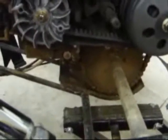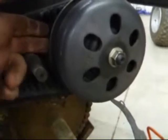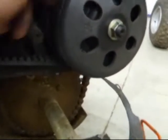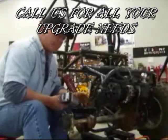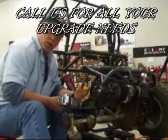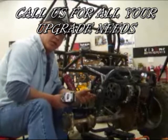Here's your variator fan right here, and then your variator is actually behind the fan. This is your clutch bell, and then your clutch slide face pulley, and then your clutch is inside here — you can see it between these holes. The variator is one of the easiest and cheapest things to upgrade. You can get a lot more low-end torque out of it, or even raise the top end a little bit, depending upon the type of sliders or weight sliders that you put in there.